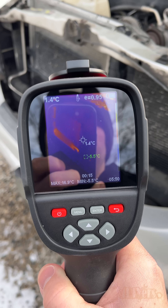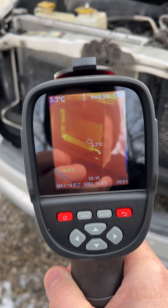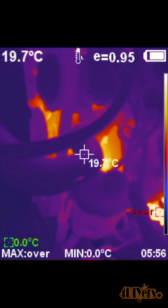This is a great way to visually watch for temperature changes. With the color scale, the blue colors indicate cooler temperatures while the bright orange colors indicate a hot temperature. This is a great test to determine if your thermostat is functioning correctly — being closed when the engine is cold, then opening up to allow coolant to flow through the radiator once the engine reaches operating temperature.